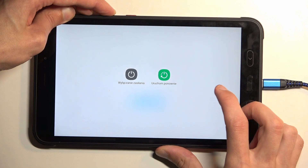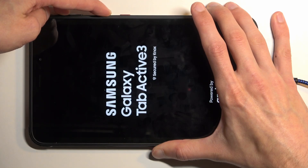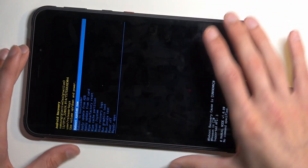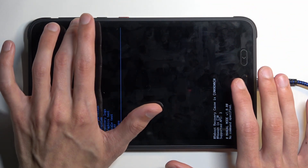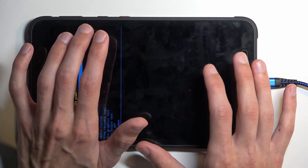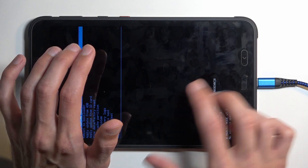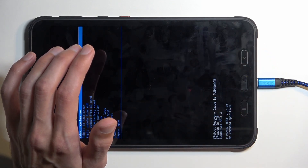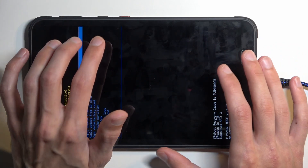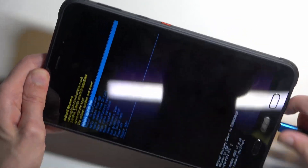In typical circumstances when you have your lock screen visible, you want to interact with the display, because once it switches off you want to see it, and then when it turns off you want to switch to volume up instead of volume down. So to recap: from a lock screen, hold power button and volume down, and you do want to interact with the display because it might time out quicker than the reset timer. Just touch the display, fiddle around with the pattern, pin, or password, and once the screen turns off it means the device actually turned off. You then want to immediately switch from volume down to volume up, and this will boot you into recovery mode.